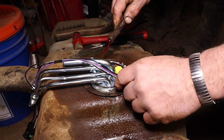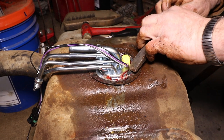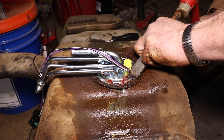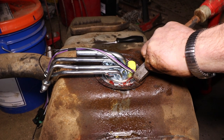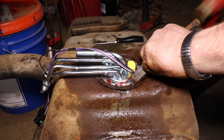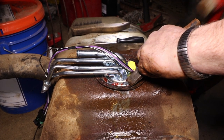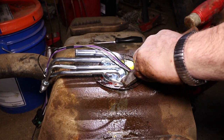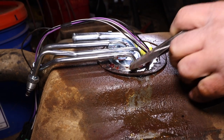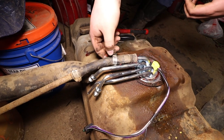Make sure the o-ring is properly installed beneath the pump. We then greased the area for the locking ring so that next time it shouldn't be as difficult to remove. To tighten the lock ring we used a similar method to removal — just hitting it the opposite direction to lock the fuel pump in place.